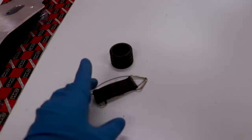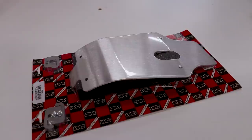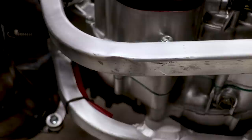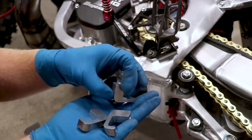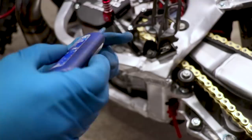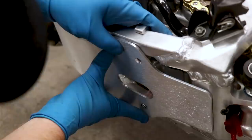This piece goes on the joint of the silencer and pipe, and then we've got the gas tank strap. We've also got a Works Connection skid plate — let's get this thing fastened up. You can see the frame already has a dent in the rail from before, so we definitely want to prevent that from happening again and protect those fresh cases. There are four brackets here — three are the same and one has a shorter angle, which goes on the right rear. The screws you'll definitely want to Loctite; without it they'll back out pretty quick with all that vibration.